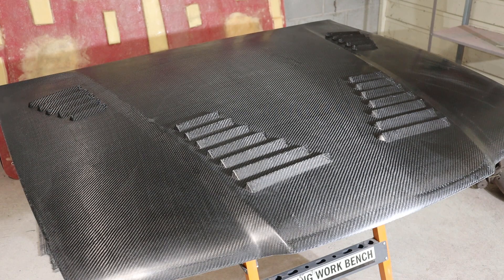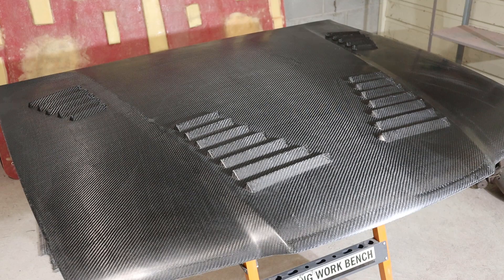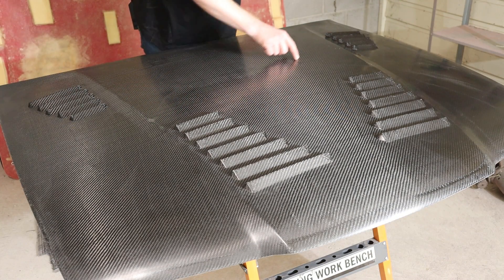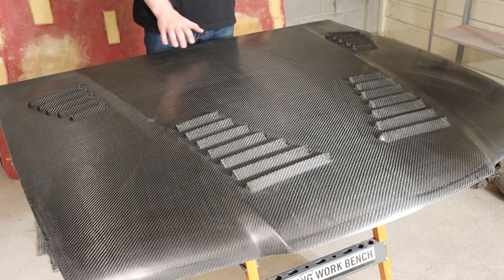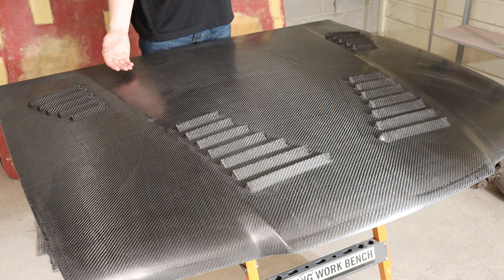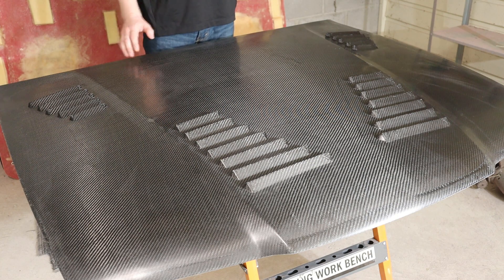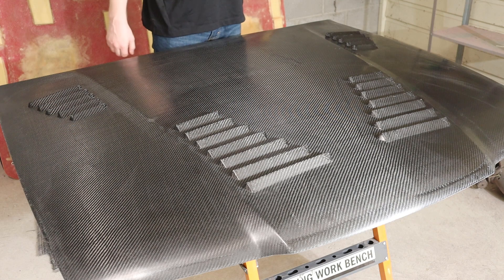So the general concept here: I'm making this bonnet with two layers of carbon fibre on either side of a 10mm thick polyurethane foam core. There's an additional layer of foam running through some key areas, just to bring a bit more reinforcement to this large surface area. The carbon on the outside is 200g per square metre 2x2 twill, and on the core side is a 300g per square metre stitched biaxial running at 45 degrees — so we have a 0/90 and then a 45/-45 mirrored about the foam core.